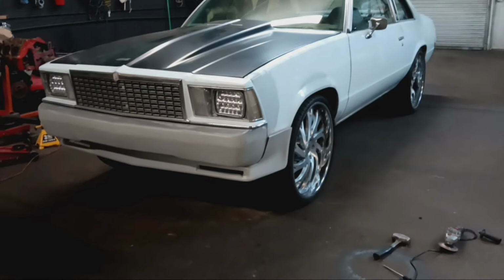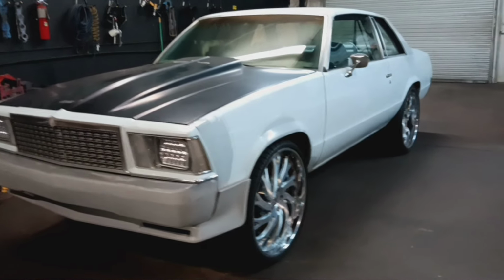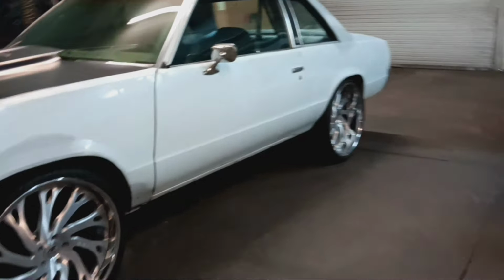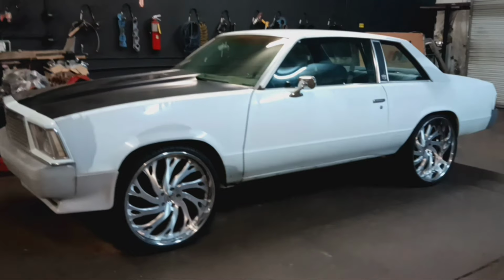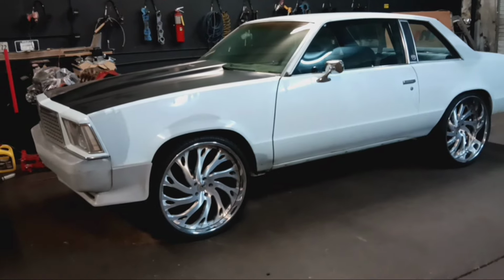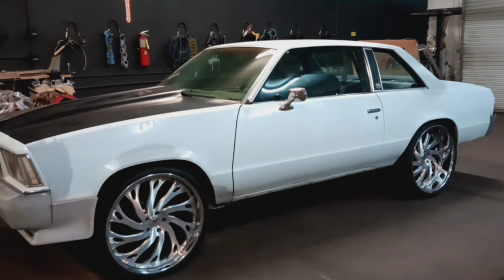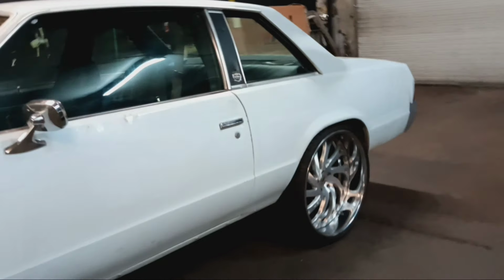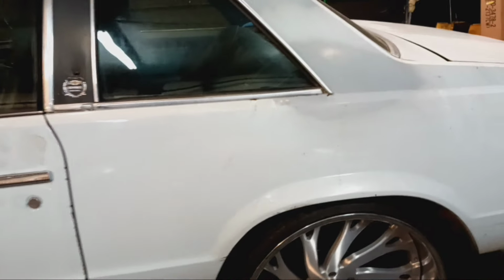All right, we got all four tires on. I got everything that I showed y'all that I was putting on the car on, except for the Moroso trick springs. So when I installed the springs, for y'all that don't know, one of them comes longer than the other, and one is stiffer than the other. When I put the springs on, the car sat extremely too low, and it caused excessive rubbing and grinding on the tire. So let me show y'all what I'm talking about and why I had to put the stock springs back on,